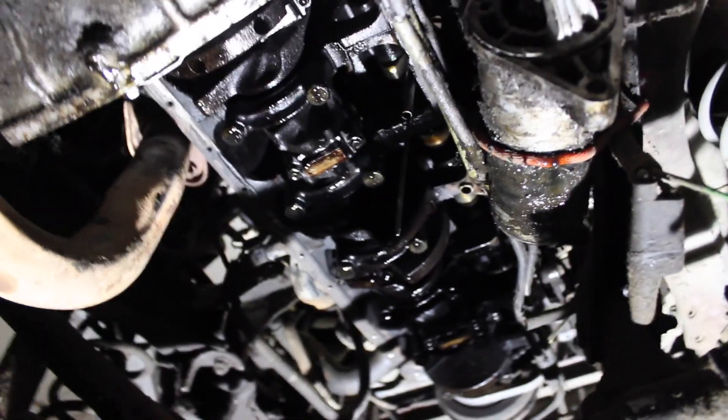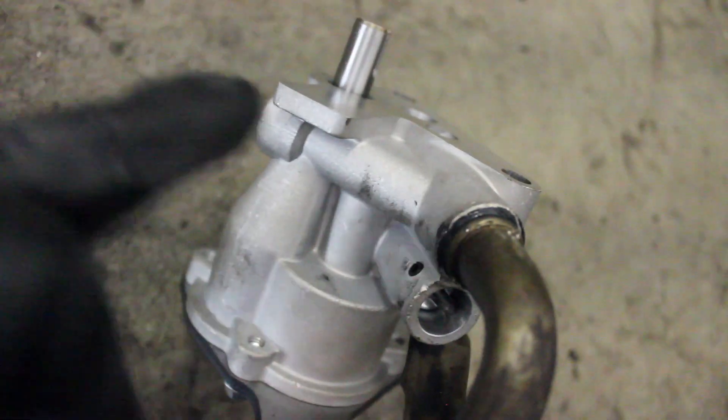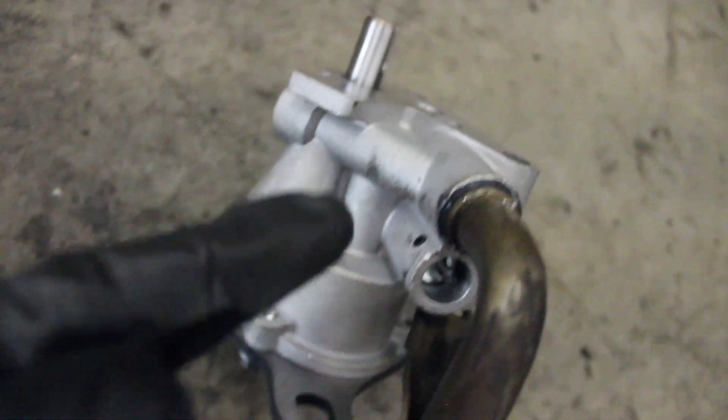It's really straightforward to unbolt it from the engine — it's two bolts. Mine were 13 millimeter. They're up there right by the dipstick where it's poking down. You just unbolt those and the whole thing falls right out. I had to use a rubber mallet to tap out the old pickup line. Then I just put a little bit of RTV on the old pickup line before I put it into the new oil pump. Tapped it in there again, then lined up the bracket with the hole.